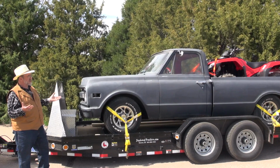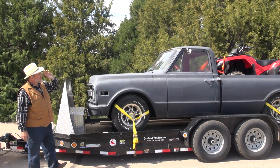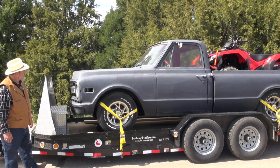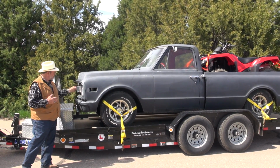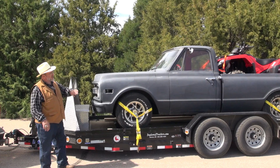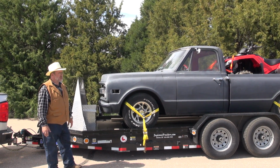And it's kind of a half of a lowrider, that's what they were working on. So we've got the cool wheels, it's been lowered. You know, we've got to work on the roof, on the gutter, but it's a nice running truck. We're also going to convert this to a 72 grill. I have that, which means we got to replace the bumper because the blinkers go in the bumper now. So we're going to do all that, put a roll pan on the back bumper, and finish this truck. This will be our project for this year.